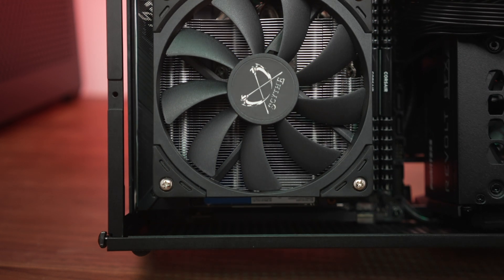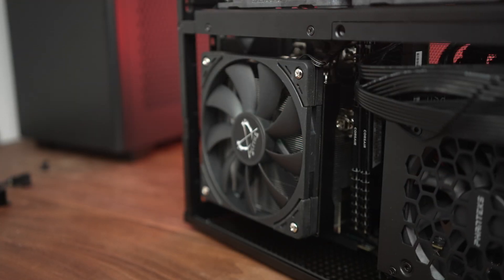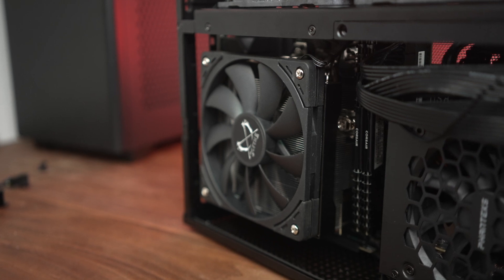So at least I think the results are still valid here; I just don't know about the long term. It's the same number of heat pipes — five total — but a much bigger heat sink on this cooler. And we'd expect it to be the superior cooler because of that, even though it's tighter to install. Testing data was gathered with the Ryzen 5600. I think this or the 5600X, 12400, or 12400F from Intel are very suitable chips to pair with these smaller coolers.